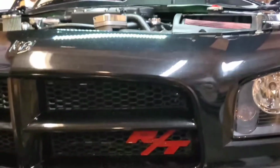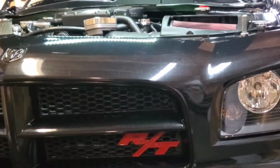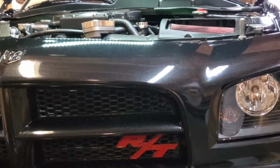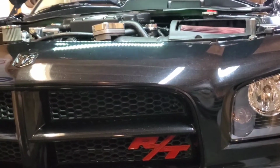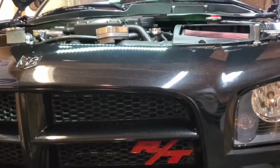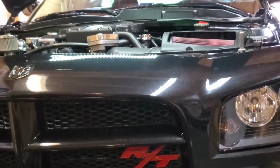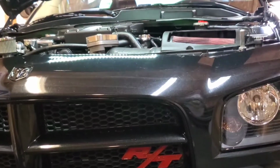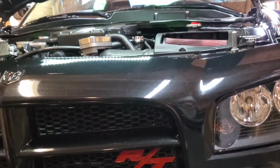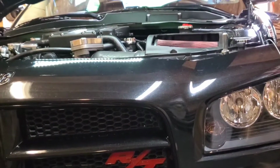Alright, now that you've seen the clips, we got an updated tune with a little bit less timing in it because it was getting spark knocked before. We might tweak it just a little bit more. We're going to see, but overall, I don't think it's going to get any quicker on 93. It still is on 93 octane. Car's full weight.